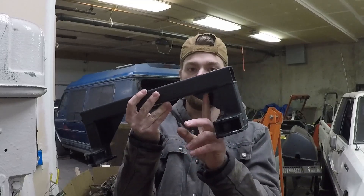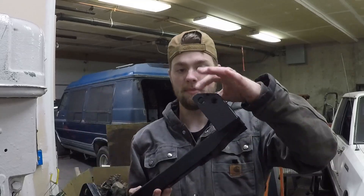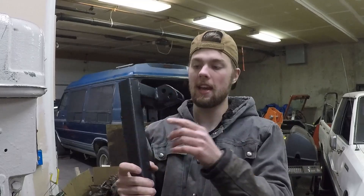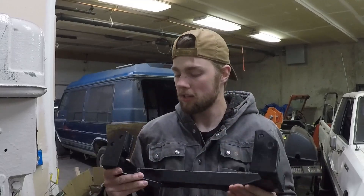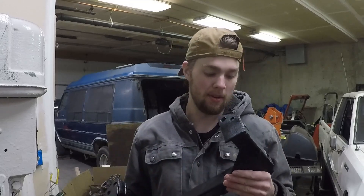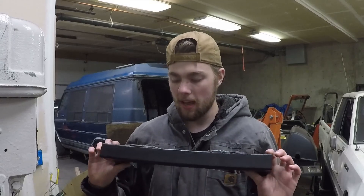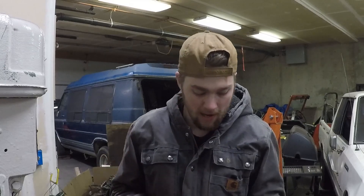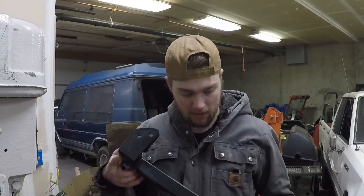You'll notice this is around 42 degrees-ish, which brought this end in, and I had to go and ream this just a little bit with the hand drill while I was under there. Not a big deal. At the end of the day it's just a little bit unsightly, but it holds good — it's not going anywhere. You could pick the truck up by just this unit alone easily. It's a lot stronger than the factory unit. I didn't end up using any of the factory stuff; it was just easier to use this square tube from the scrap pile. Didn't really spend any money on it — just all repurposed stuff.